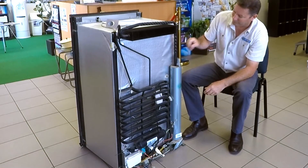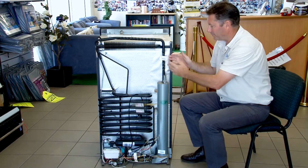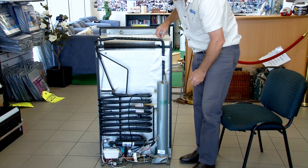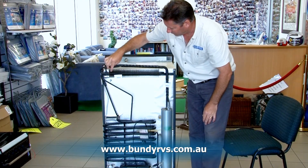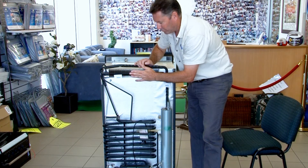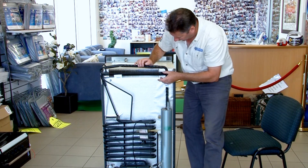Down the bottom here there's our burner. It burns, heats up, and boils the water and the ammonia, turning it to a gas, which comes up through here. Now these little dimples here — that's actually a water separator — that's where the water is separated from the ammonia. The ammonia gas travels up through this tube and comes into this one here, which is called our condenser. You have to have a good flow of air over this, which converts the ammonia gas back to a liquid.